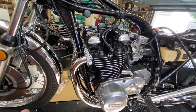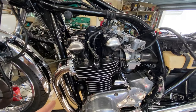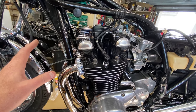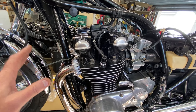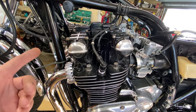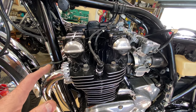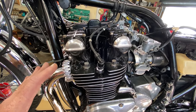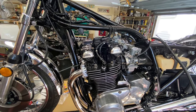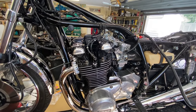What else can we do to improve this? If it were mine, I'd pull the head — leave the jug because that seems okay, it's a half-mil over — pull the head and do a shotgun job on it in-house. I probably wouldn't change the valve guides unless they're out of spec. I'd send it out for that if needed, but if they're within spec I'd slam it back together with new valve stem seals, clean the valves, lap them in. But that's not part of this job — that'd be a lot of money for the customer, and we're already into this quite a bit. I've got it running the best I can at this point.